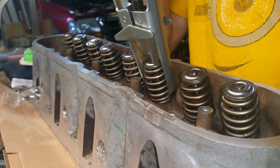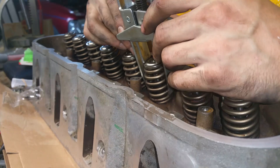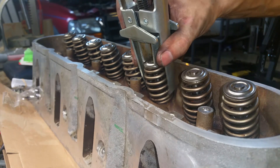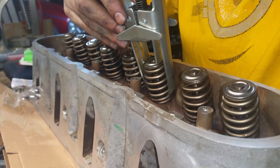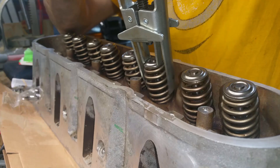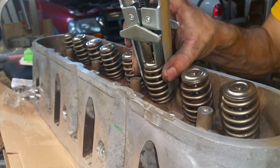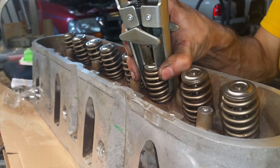Alright, I'm going to start doing these valve seals — already did this one. I've got the valve spring compressor on it. This is kind of a jack-in-the-box tool if you don't have it set up right — it'll pop off. It's basically just a puller to compress the spring. I usually like to hold these together at the bottom of the spring, otherwise it'll pop out.